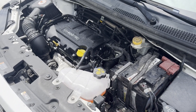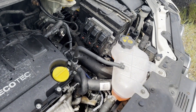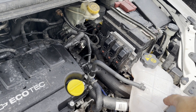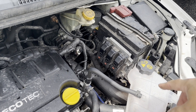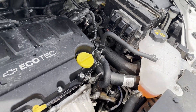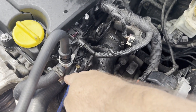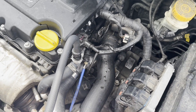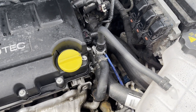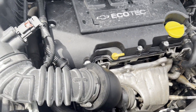This is a review after driving it. There are videos on the burping process — basically you leave the cap off, fill it, leave the engine running, then shut it off, put the cap back on, drove it around about a mile, came back. It's pulling coolant down. Had it running and looked at all the connections — the other day it was spewing fluid right out of that area. So watch out for that — make sure it's not gushing fluid when you button everything back up.